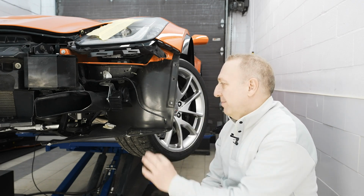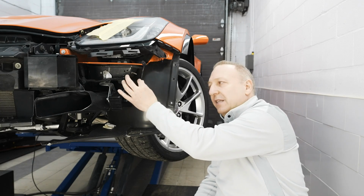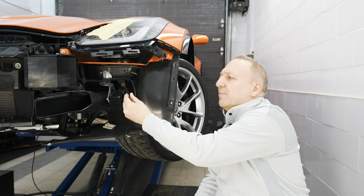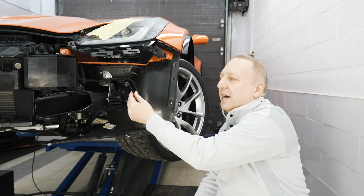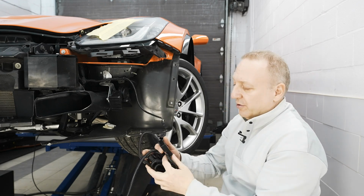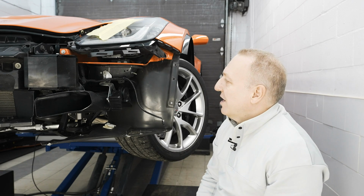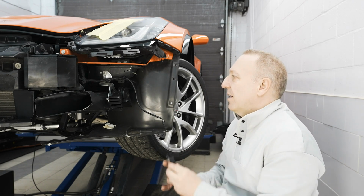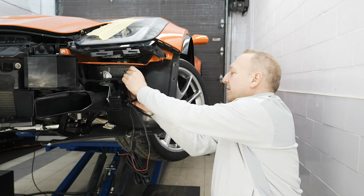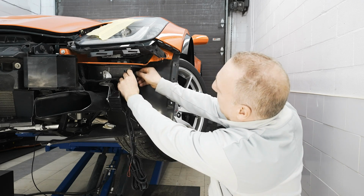Now to wire all this up, like I said, we'll be exposing 2 wires inside this harness, just one side, this side here. There's a purple wire and a black wire. Obviously black is ground, purple is power or hot. And we have our controller. The controller itself will be installed on this stud. So every car actually has a stud that's not used. We're going to utilize this. And all we do is we slide it on and we supply you a 10mm nut.